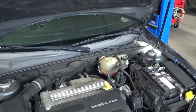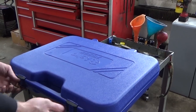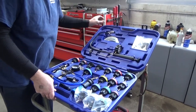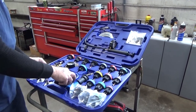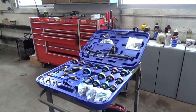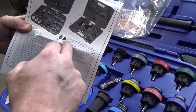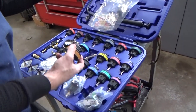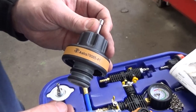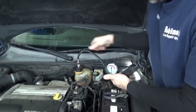I doubt this was the reason for the leak and the stain down below. Let's put a little pressure on there and see if we can find anything. This is the Astro 78585 coolant testing kit — their master kit, I believe. I haven't really used it much. I don't get a lot of these type of jobs as much as I used to, but then they come in spurts. With Saab being GM, I would think it would be the later model adapter you'd need, so your kit may not have included it. It's the 7858541. Feels good.